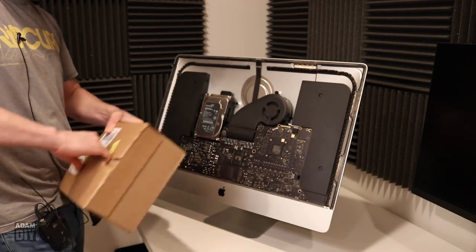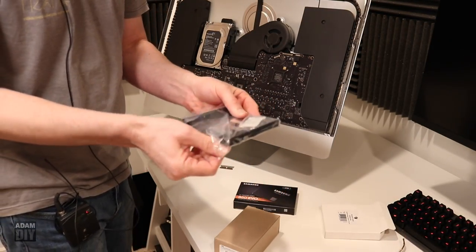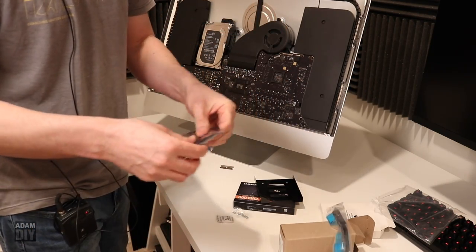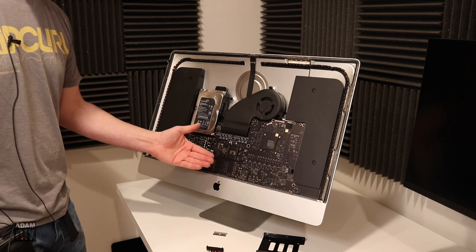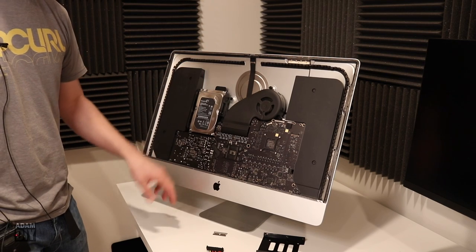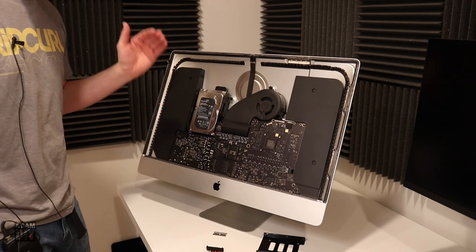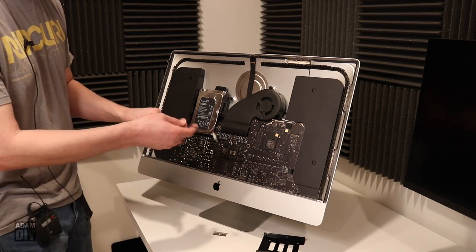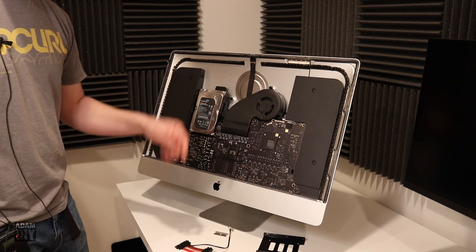Here are the parts I bought. I'm going to install this Samsung solid state drive. This is the mounting bracket, and here is the replacement foam tape. This is the thermal sensor for the hard drive — the hard drive communicates with the computer and tells it its temperature. If you put in a hard drive that doesn't have that sensor, like this one, the computer by default will just kick the fan on to full power and it will drive you nuts. It is really loud and it won't turn off — the second the computer is on, it's on full power. So make sure it's a compatible new hard drive with the thermal sensor. If you're not going to put one in, you need to buy this thing — it glues onto the hard drive and communicates with the computer so the fan is not going to be running full blast.